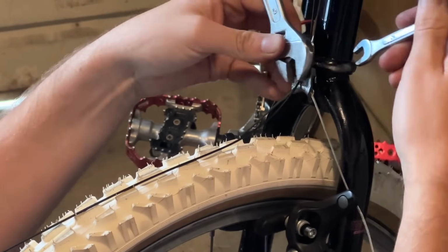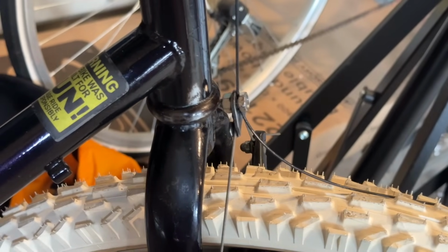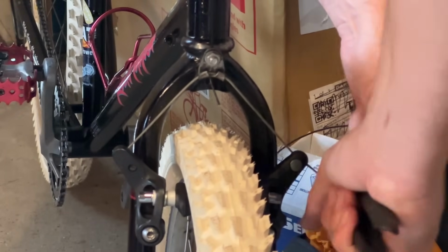Ideally, you want something underneath this as well with an aggressive front tire. If that front brake cable snaps, the straddle cable is just going to ping straight down and lock on the front tire. I then realized that the cable hanger was hitting the lower headset cup, so I had to flip that around. And then just trimming the cables down and crimping on some cable end caps.